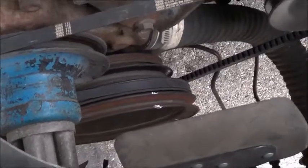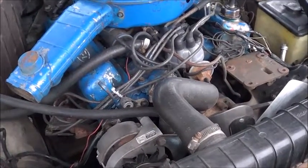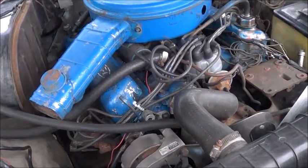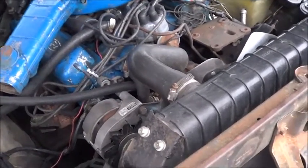You can see back there that mark on the pointer is top dead center, and then I marked it. You're supposed to mark one right at top dead center, then one 180 degrees from top dead center, and one 90 degrees clockwise of top dead center. We're going to tighten down specific rocker arms at top dead center, then spin it 180 degrees and tighten down more, then spin it to that third mark and tighten down more. So let's jump right in.